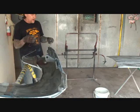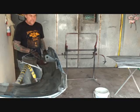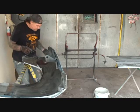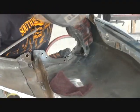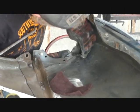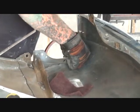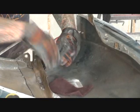Since we're going to paint these off of the car, I'm in the process of removing a piece of molding. The only way that you can put this molding on the car is you have to have the fender off. So we're going to take this molding off, and then once we paint the fenders we'll put it back on — it'll give it that nice clean look instead of having a tape line around the molding. The only problem is getting the right socket that actually fits it. Make sure that when you take your moldings off, always put the screws back on to the clips.